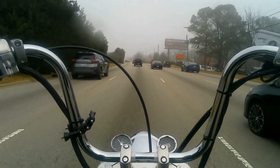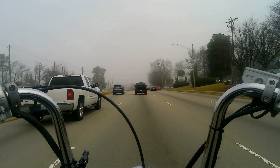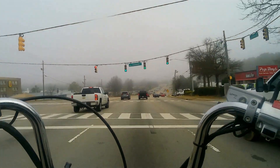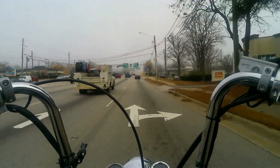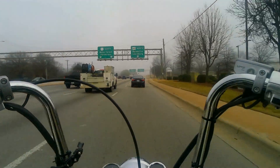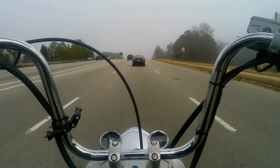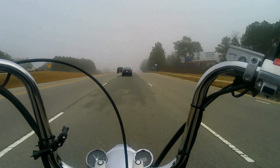If I go wide open, she's hesitating. That 1/16th drill bit puts us at about a 158. I think I'll go ahead and order a 150 main jet. I don't want to buy a whole kit — I don't think I need a whole kit. Because in the lower RPM range she does fine. She pulls like crazy. I can feel her stumble just a little bit, so that makes me think we're just a hair too big.